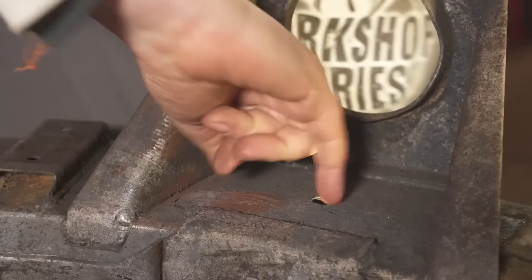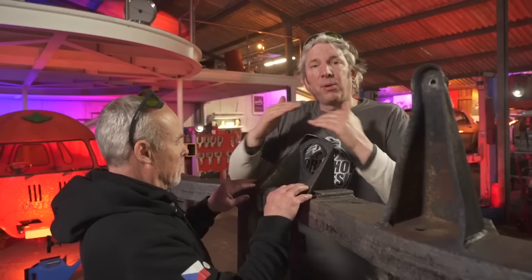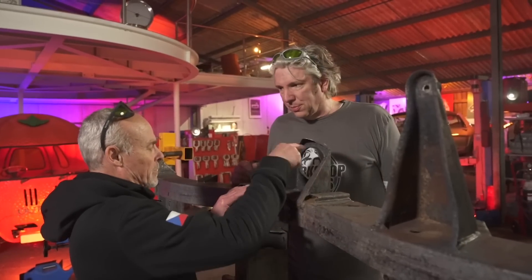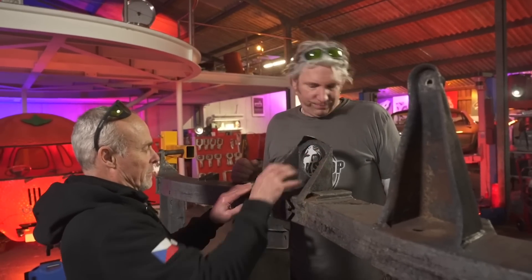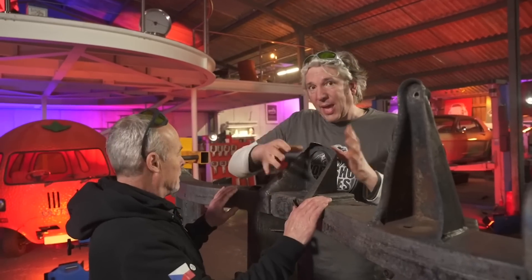And then here is even worse, actually. If you put your finger in, you can actually feel where the metal is so rusty it's actually blown inside. There's obviously a number of layers. And this is quite a fundamental part - it holds the top of the spring. So we're going to have to definitely fix that, but it can be fixed.